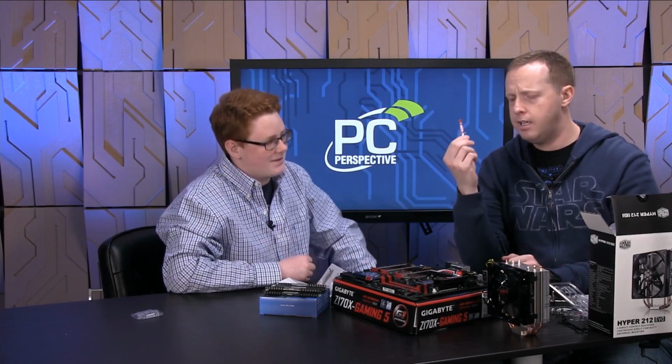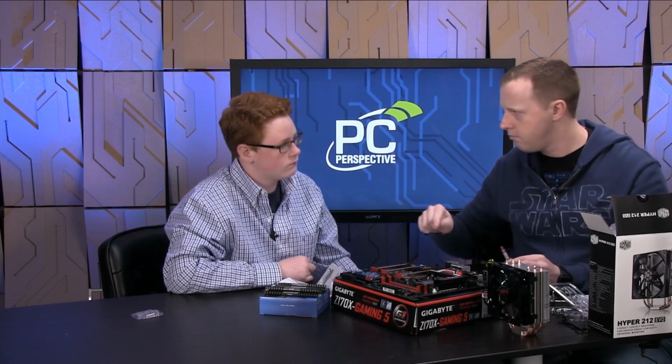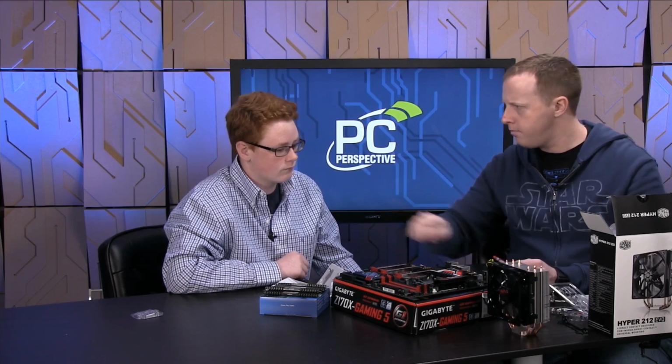Now it's time for the most sensitive discussion we'll have today, the application of thermal interface material. Austin, you won't believe how many people out there have varying opinions on how you should install thermal interface. Some people say you put some on with your finger. Put it on your finger and apply it to it. Some people say you put some on and use a credit card to lay it nice and flat. Other people will say that you put it on, put the heatsink on, take the heatsink off, wipe off the extra from one of them, and then leave the rest.